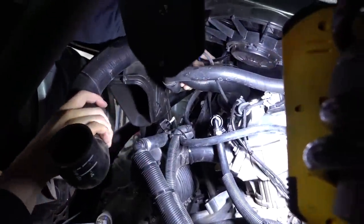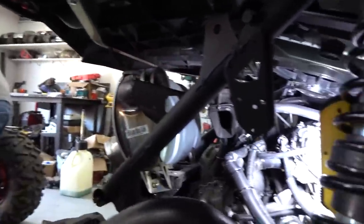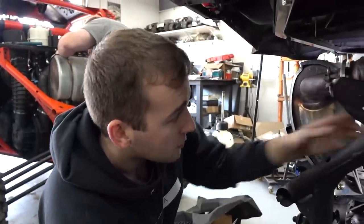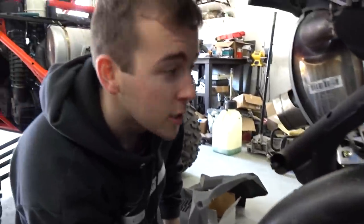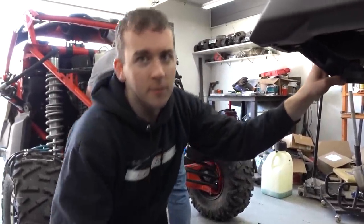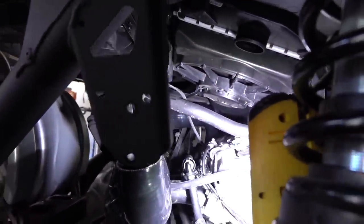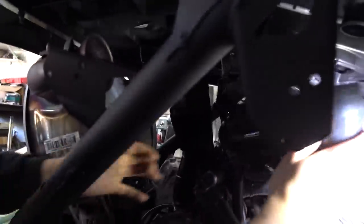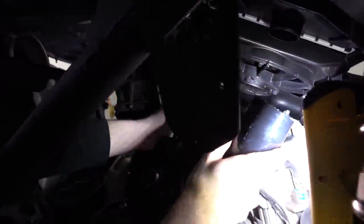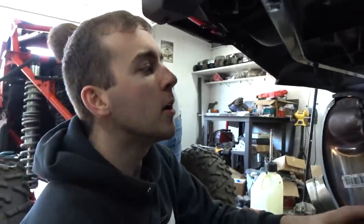Charge tubes coming out — took it off the intercooler on one side and off the throttle on the other. Same thing as the injectors: if your machine is muddy and dirty, put something in your throttle body so you don't have mud or anything fall down there. The charge tube is one big long piece and it's kind of sticky because it's made of silicone. Wait — I think you've got it upside down, 180'd out. The BOV port should be pointing down back here because the BOV is going to run right there.